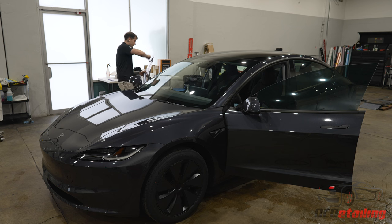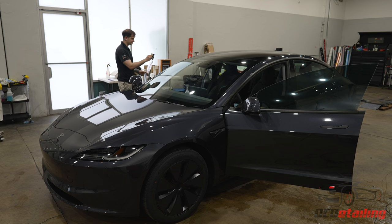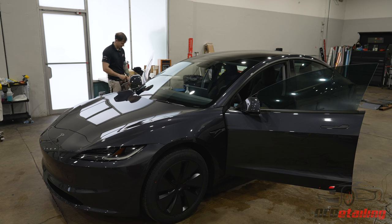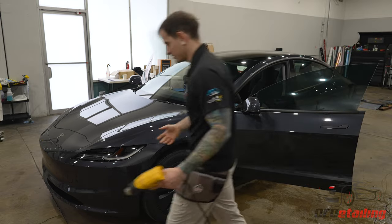I keep all the doors shut in the shop. I actually get upset with everybody if there's too many people walking in and out while I'm working, because every time that door opens, a gust of wind comes in and brings contaminants in from the outside, then I'm dealing with more contaminants inside the shop. I also don't want any airflow in here, so there's no fans. I even turned the heater off just to tint this car to make it look as nice as possible.